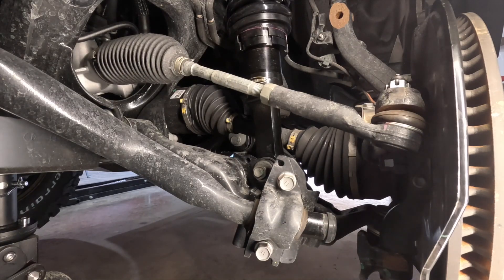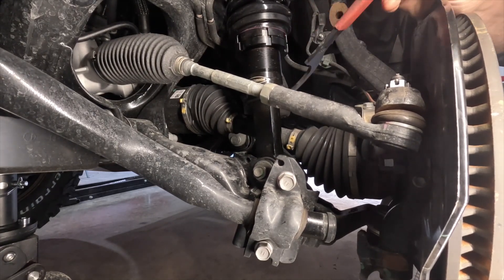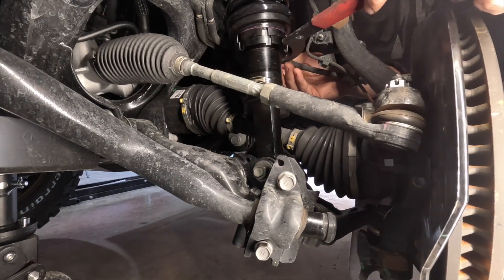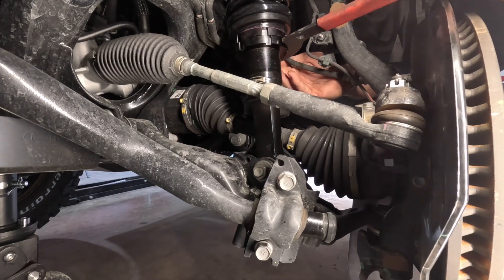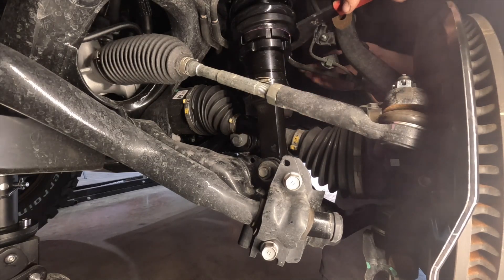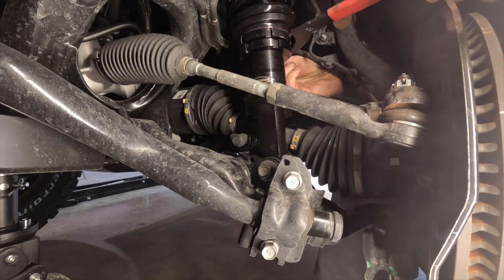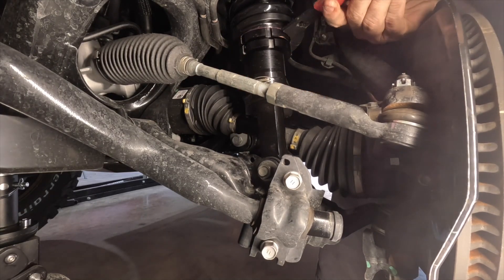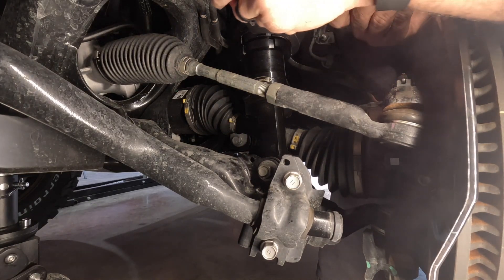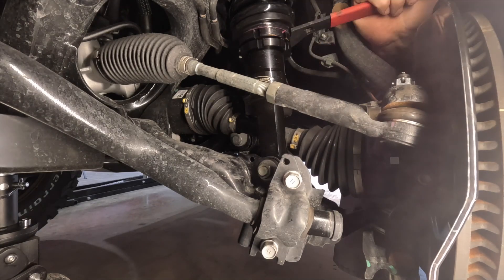We want to come down a quarter of an inch. Dobinsons includes spanner wrenches but they're a little short, a little thick, and kind of hard to use — we'll put a link in the description to the ones I've been using for a couple of years. We loosen the lower collar and bring it down to about where you want it, roughly a quarter inch. Then the top collar is the one that actually has the weight on it, so we start loosening it. When your coilovers have miles on them you'll have to take them off and use a strut compressor — they're a little stiff until they get moving. But it's okay as long as you lubricated it properly.